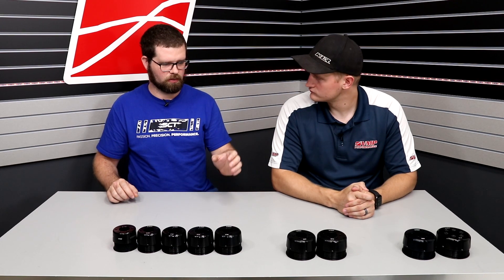When you're talking about this much boost on a stock engine, or even a modified one, I just really want the insurance and reliability of a race fuel or E85. With this section right here, you're at the top end of the spectrum, at a pretty good amount of boost for a stock engine. This is like where I recommend stopping on a stock engine. If you're one of those guys that's like, 'I don't care if it blows and takes out everything in the process — I got to race this weekend and I need to win,' okay, step into this range, but know that you're dancing with fire.